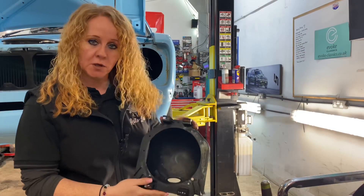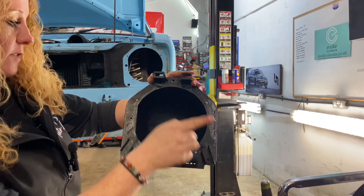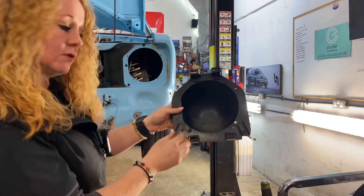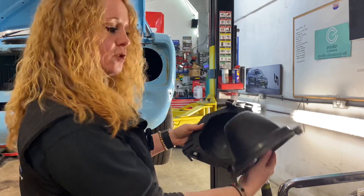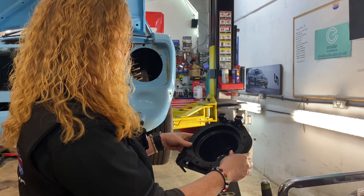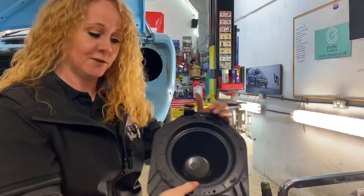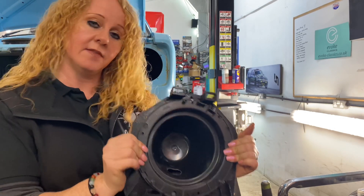The webbing has all been trimmed off the top as well — just giving it a clean-up and ready to go. These holes have also been made bigger so the adjusting screws can slide through. Make sure your gasket's on flat and then you line it up. The hole's been made a bit bigger — not the prettiest but it's big enough. I'll fix that in place and then fit it to the car.